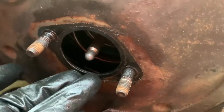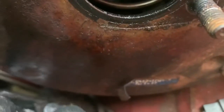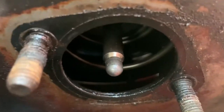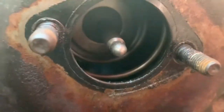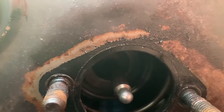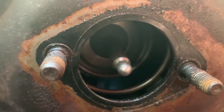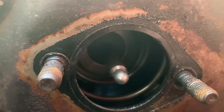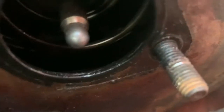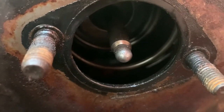The master cylinder is now off in one piece. There's a nice layer of rubber around here from where the old grommet was, and it looks like it wore out right below, which is directly where there was fluid dripping down originally. It's really gunked up and dirty so I'm going to have to clean it, but I'm going to show you the inside so you can see what it looks like. When you press your brake pedal, this little piston will push into your brake master cylinder and that compresses your brake fluid. That's then sent down into your brake lines at pressure and it goes into your brake calipers. It's pretty simple, and once you learn how it works, it's easy to diagnose where things fail.